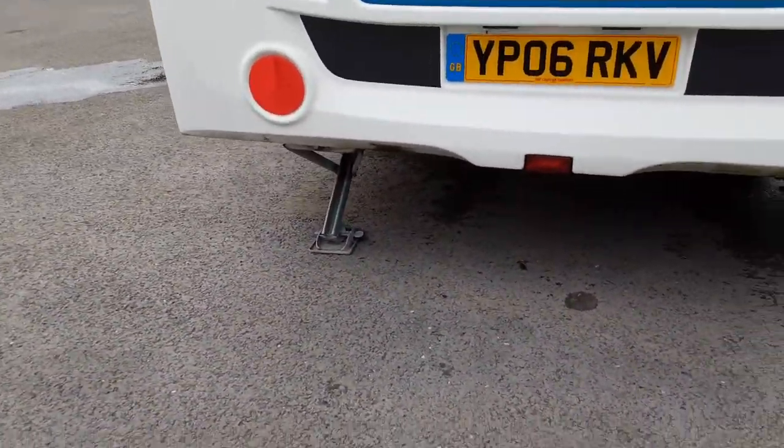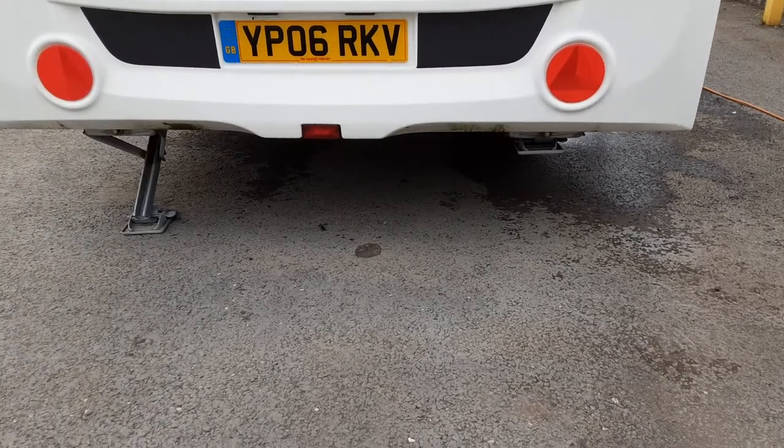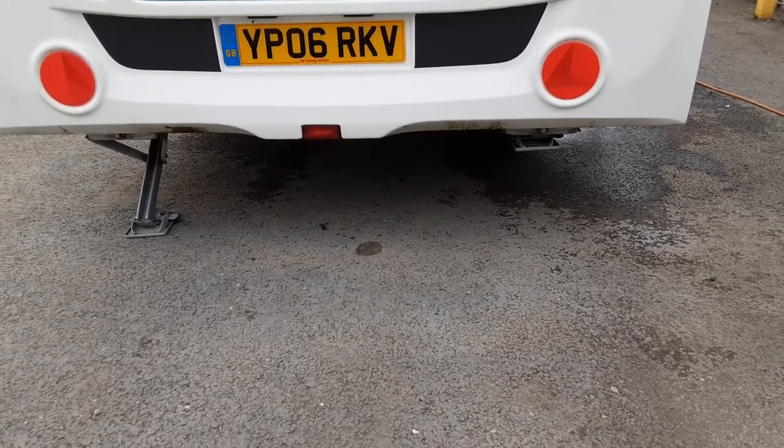In that cassette you'll put one litre of water and a cap full of the blue fluid prior to use. On the rear of the van you have your wind-down legs on either side to stabilise the caravan — again, just for stabilising, not lifting the caravan.